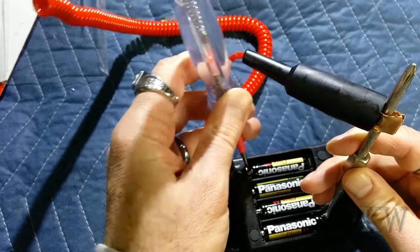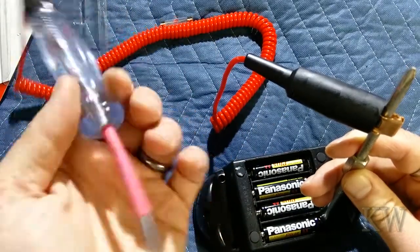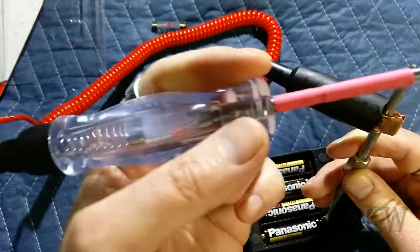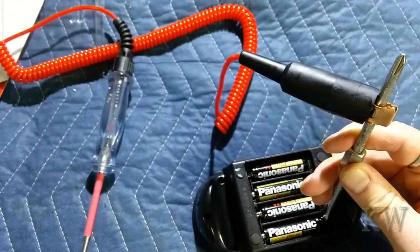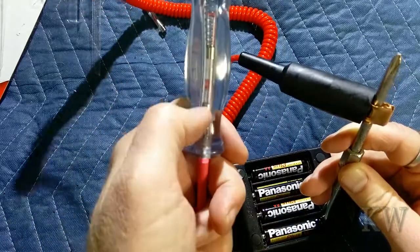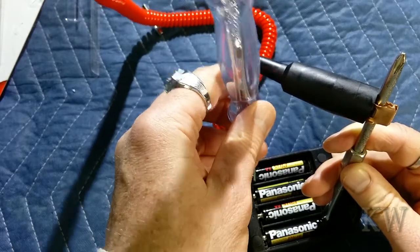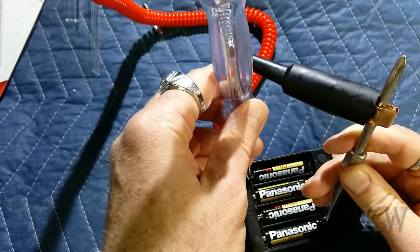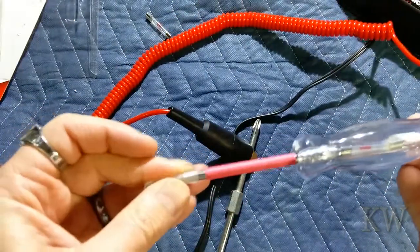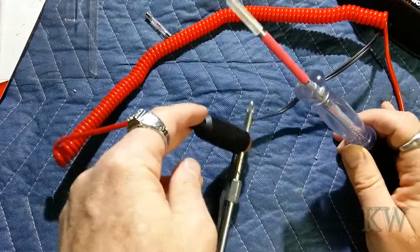It's pretty simple and actually really handy. Sometimes it's better to not take out your $800 multimeter if you just want to do some simple testing - like do I have voltage from the fuel pump or some other thing. You can just be under the car and do some probing around. If you do hit something hot and pop the little bulb, not a big deal, you've got another one. And it's kind of a cool little thing to have - even for like arcade cabinets if you just want to see if you've got voltage from one wire to another.